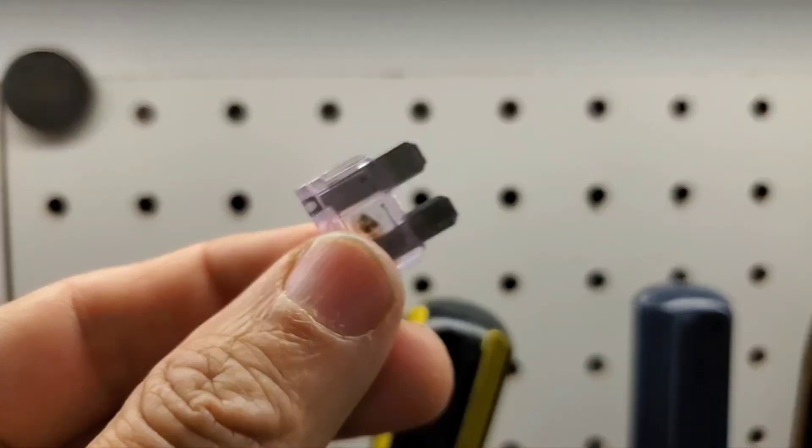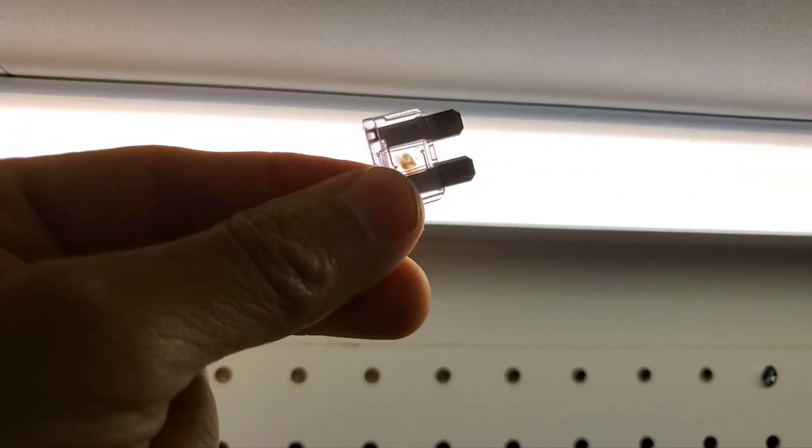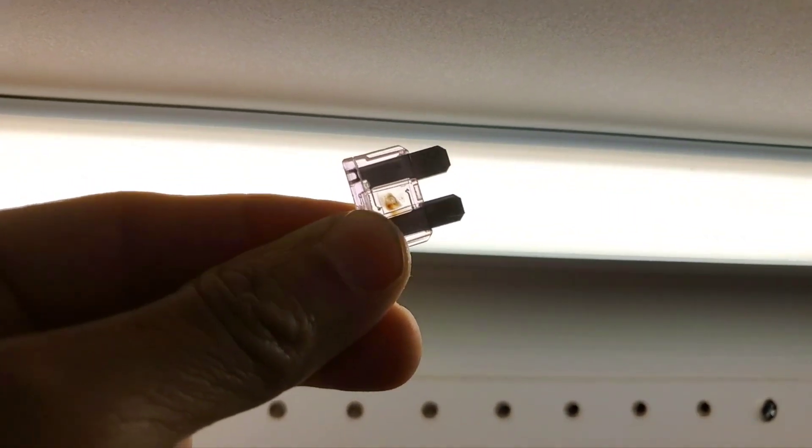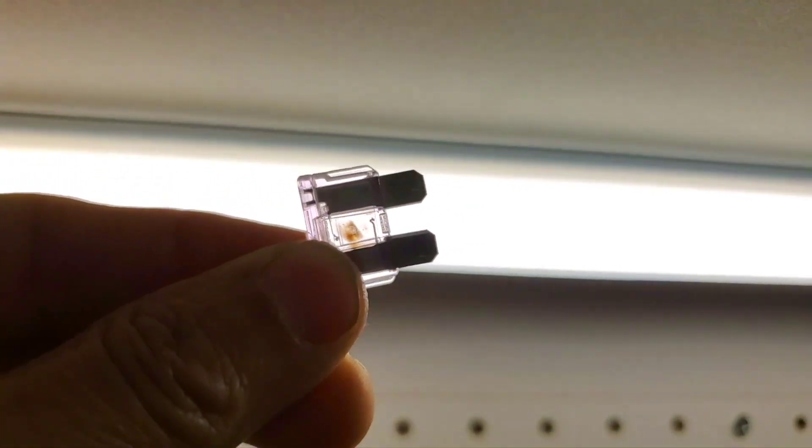So there is this little fuse — there it is, that little purple thing with the number three on it. That's the fuse to the power to that little red line. What happened was I must have touched some of those wires together, because this fuse — a common fuse found for automobiles — has that burnt spot in the middle, which means there was a little flame when that little wire got too hot and the two wires inside are no longer touching. This fuse is shot. This is the problem.